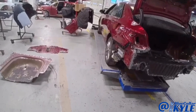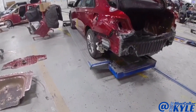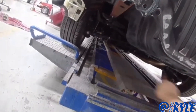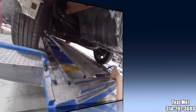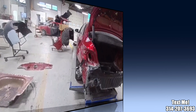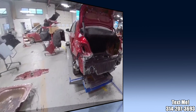I just about have this one wrapped up. I'm at the point now that I'm going to give this to our mechanic so he can put it up on a two-post lift, because the front seam on the trunk floor has to be sealed up and the suspension has to be dropped loose in order to get up to that seam to seal it. Once that's done, I'll get up in there tomorrow and get that seam sealed up and finish up the underside. After that I'll give this to Eric to do a little bit of glaze work on both quarter panels, and it will be ready for paint. That's a wrap.